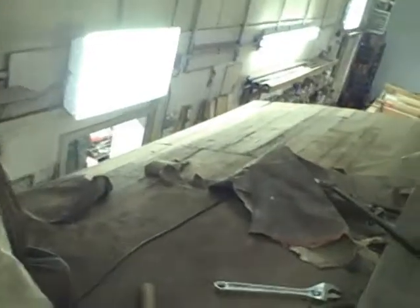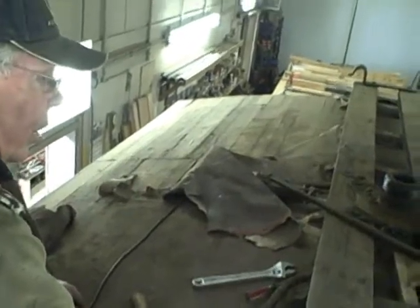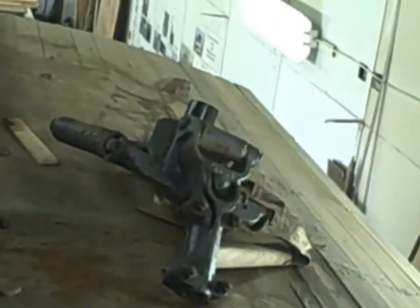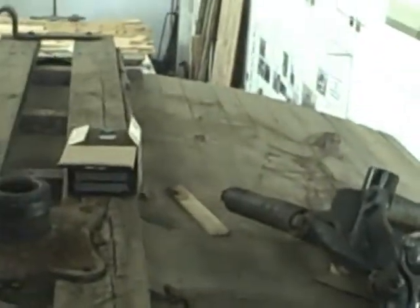You can see down the other end we've started sanding. What we will do is we'll sand the whole roof down and re-nail it first, then sand it down so that it doesn't show the boards when it's all done. Over on the other side, the car's left, you can see how that narrow stretch along the edge was done. The roof now, all the way around, has a new tack molding so that it will be a good place to nail the canvas down. After the canvas is down, there will be a half-round molding which we have yet to make.